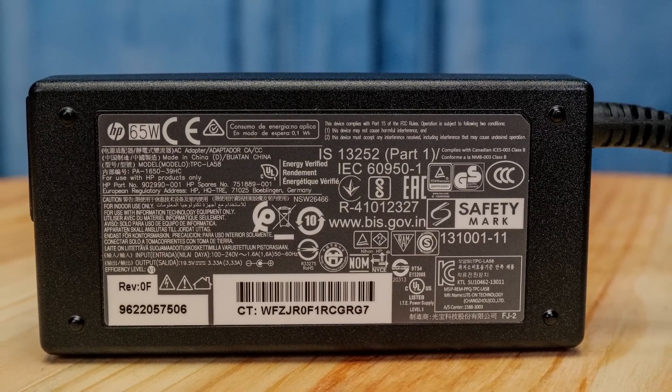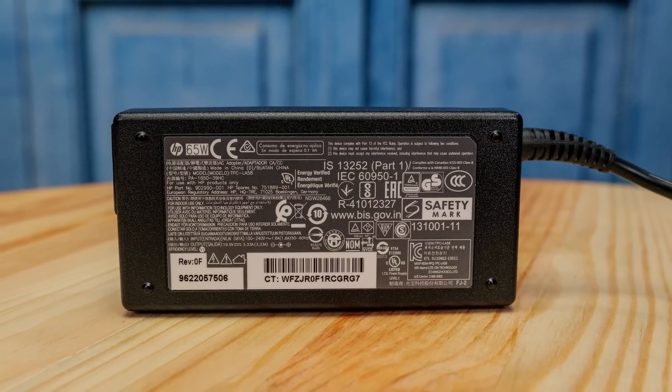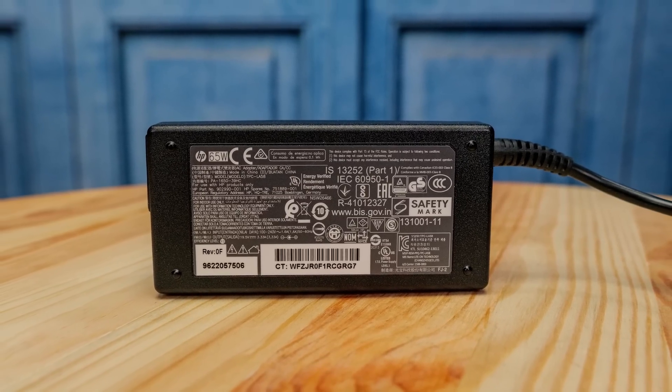Power-wise, this came with a 65-watt power brick, which is standard — a shared power brick we see across a lot of units, easy to get for HP. In terms of actual power consumption, it's very similar to what we got on the Lenovo M715Q: a little over 10 watts at idle, and you can get up into the high 50-watt range if you totally load it out with a lot of USB devices. Still, this is a lot lower power consumption than full desktop systems, and it's only about one liter.